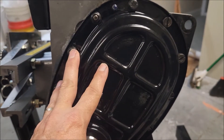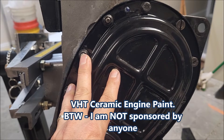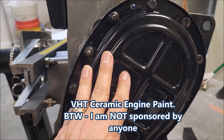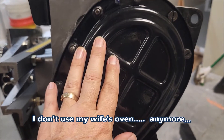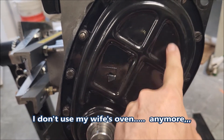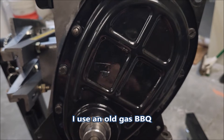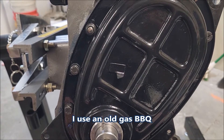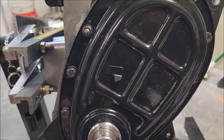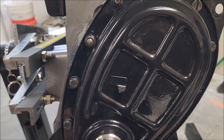For the paint on this I use VHT engine paint and bake it for half an hour at 200 degrees to make it tougher according to the directions. I did not replace the goop that goes on here — some people use Bondo to put that back, as it supposedly quiets things down. On my TR3 I did put Bondo on it to reproduce the original.